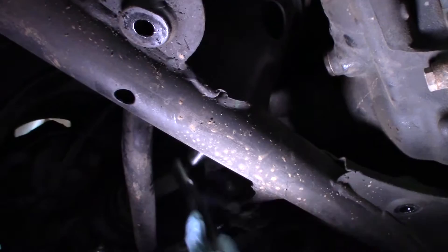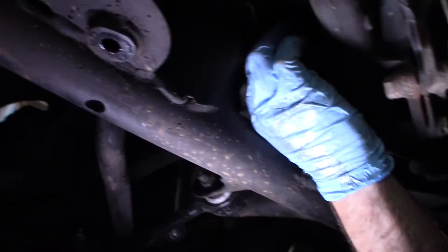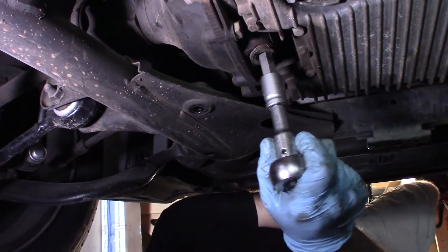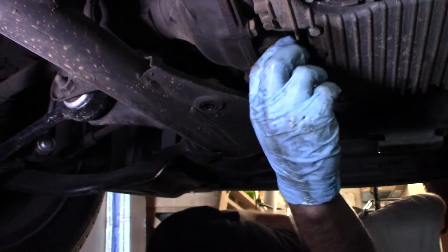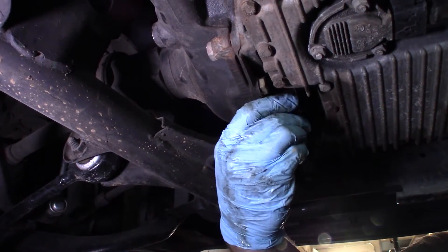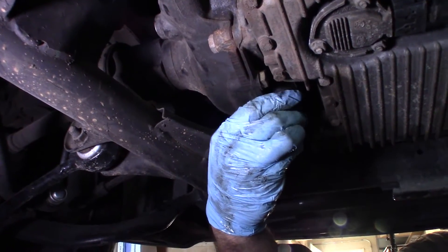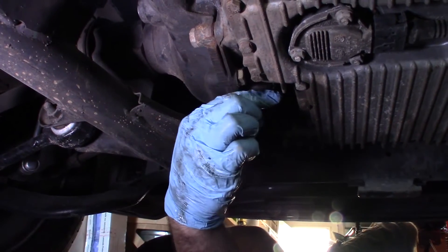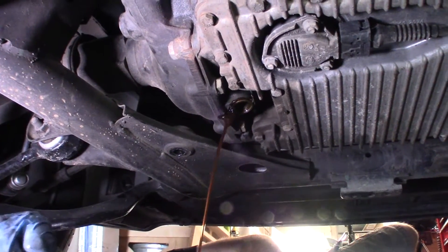You might need penetrating fluid in some cases. Looks like I got that loose pretty easily, and now I can probably just get it with my fingers. I'm going to move my drain pan below it just in case some of the oil spills out. Now we're going to crack the drain since we know the fill plug's loose. California — no rust here, you might not be so fortunate. In your case, spray it with PB blaster or your favorite penetrating fluid. Make sure you've just driven the car — you want hot fluid because hot fluid will flow faster. Since it is hot, I'm going to do this quickly and get out of the way.